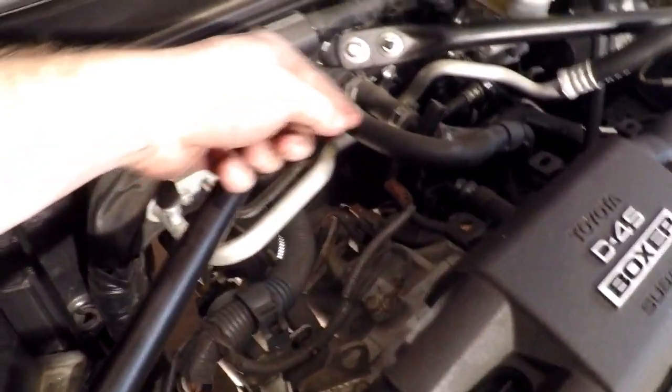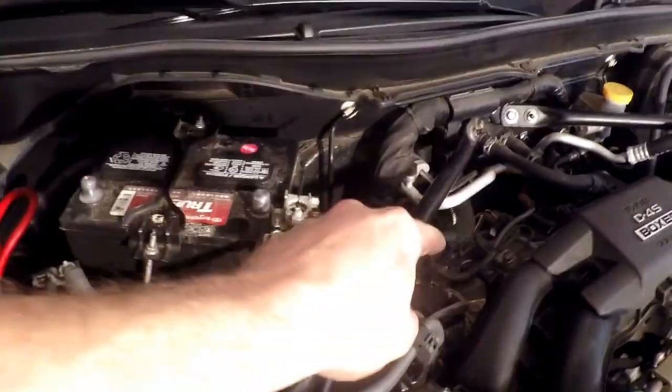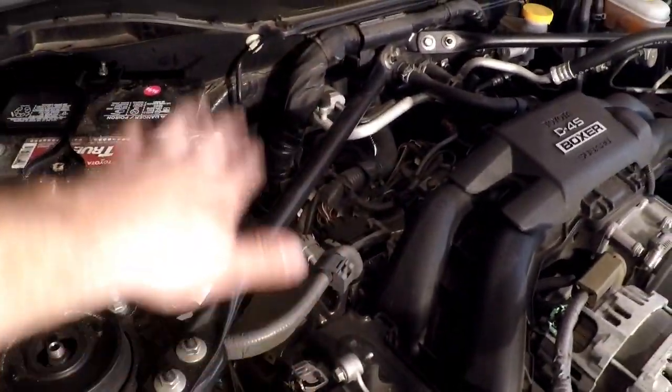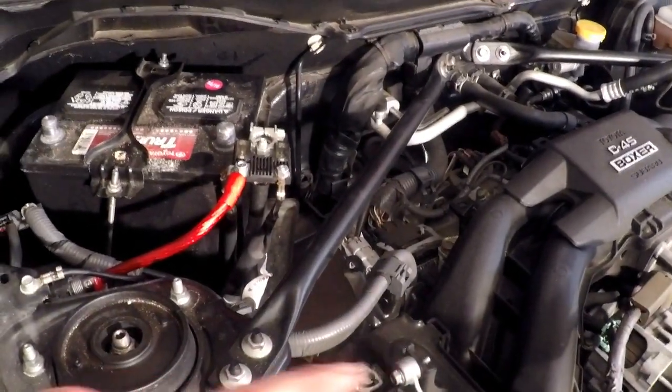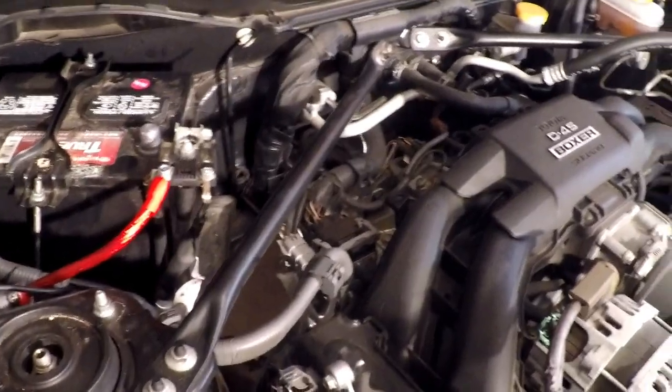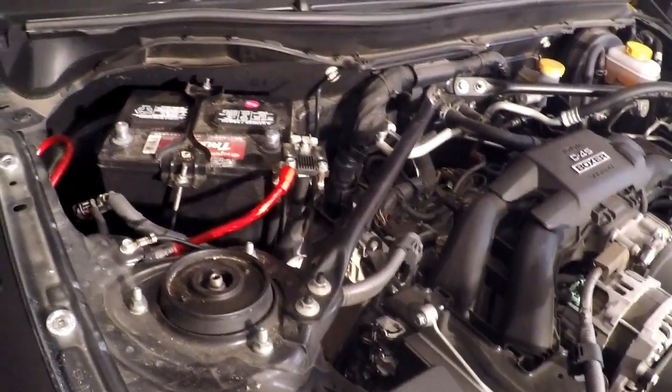But again, I actually reached up with my left arm over the top of the transmission on this side and used my right arm to help guide the socket on. And they're all 14 millimeter. And I just used 1/2 inch drive and an extension. So we can go under the car and finish breaking everything loose in the cradle. And I gotta get my floor jack under the car and get ready to support this thing. Oh, and we need to support the front of the engine, and then we can start to unmarry the transmission.